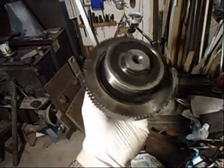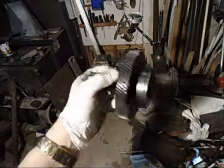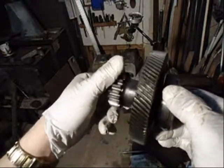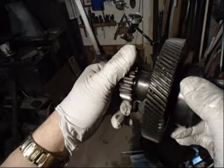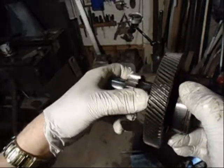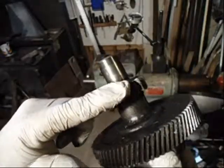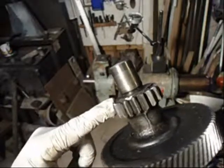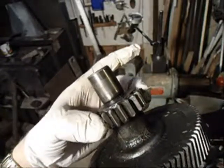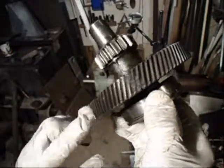This is what I was just working on — clamped that bearing in the vise down there. It's the idle gear. We're not going to reuse this gear because there's one chipped tooth, if you can see it right there. Also, the number of teeth and the diameter of this gear is different on the 87 and 88 models — the earlier models. This is a bigger gear with more teeth on it. The other gear is the same diameter and same teeth through all years. This is called your main idle gear.